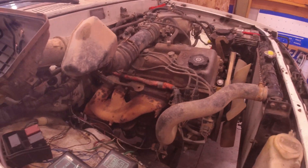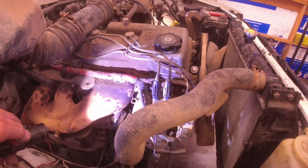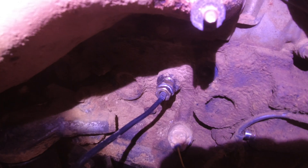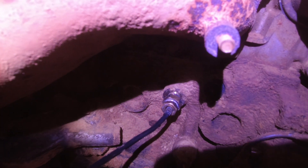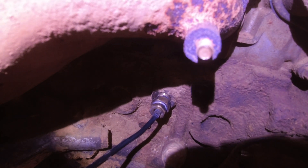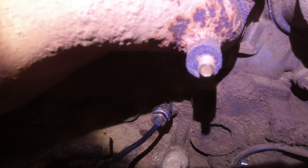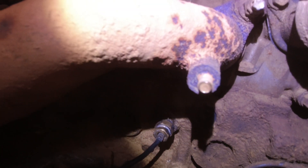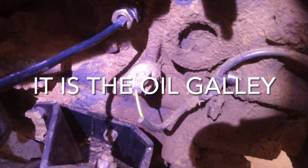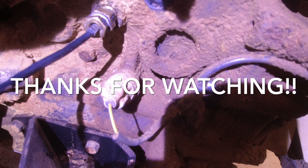One thing I forgot to mention with the cooling system: I have a manual gauge, so I took the plug out of the water jacket right there - just a regular plug - and water came pouring out, which means that's a good location to install a manual temperature gauge. And this plug right here I'm pretty sure is for oil - I have yet to clean it out and take that thing off, as you can see it's plugged with dirt.